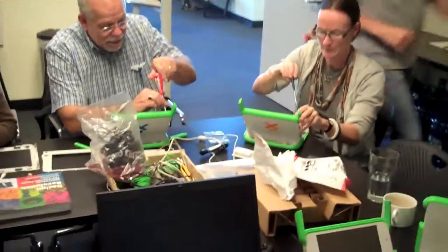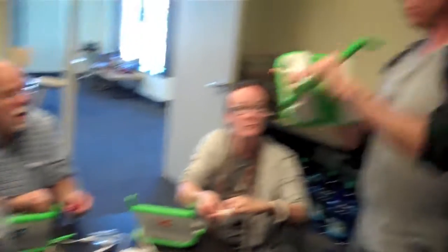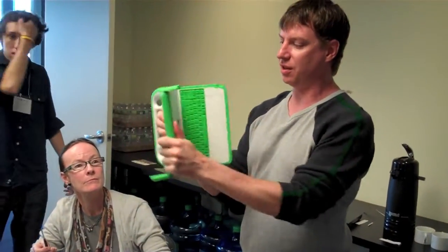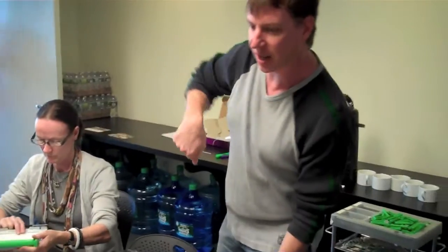Make sure you're keeping the screws in or near the plastic bag so you don't lose them. I usually find it's easier when removing the screen screws to put the laptop in this configuration — turn it all the way around and put it down so you can press down and remove, rather than try to press at an angle.